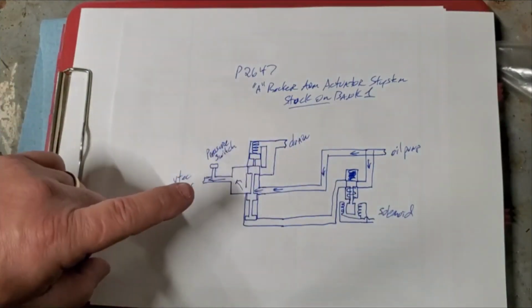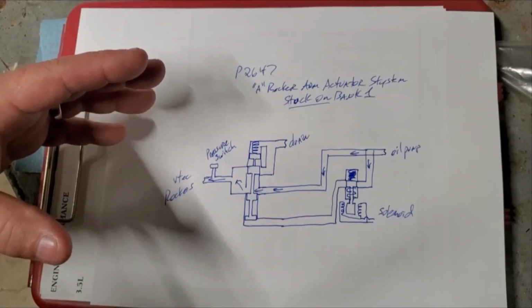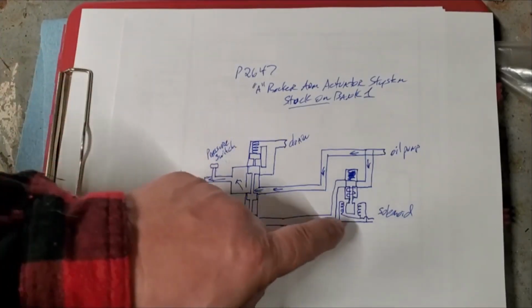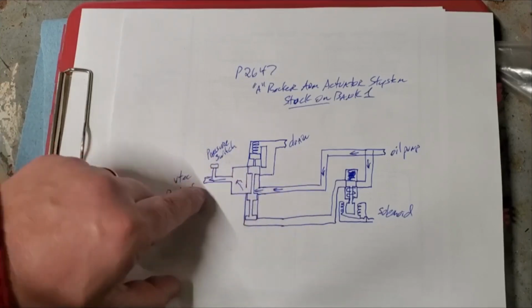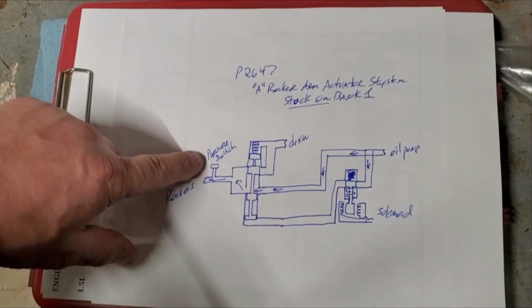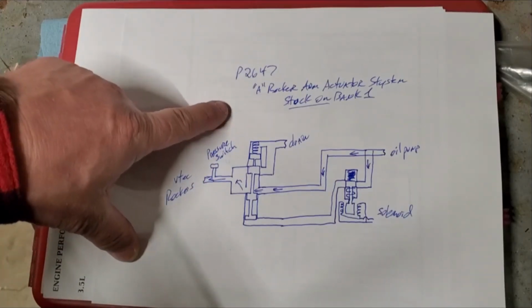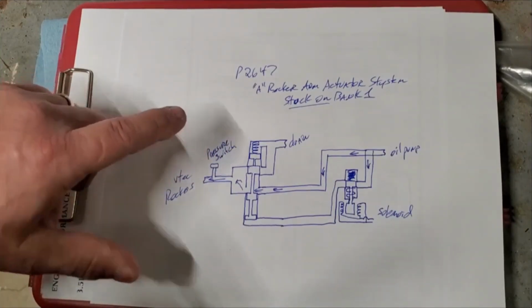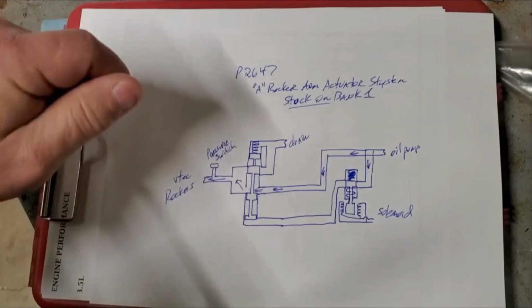Because what was happening, y'all saw the oil change fixed the problem, because the oil filter hadn't been changed in many, many miles. So what was happening, it would set it when the solenoid itself was de-energized, which is allowing full oil flow going to the VTEC. It would set it off when it was de-energized and pressure got near zero, as indicated from this sensor right here. I made a T that went to the gauge I had up on the dash, and then one into the pressure switch. I don't care how that reads at this point. What I noticed was that when it was turned off, it was signaled off, and I had no pressure here. That's what set the light off.